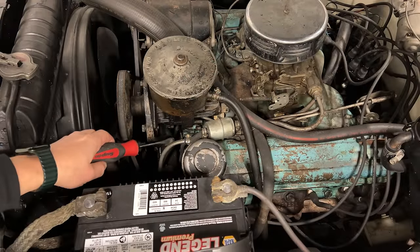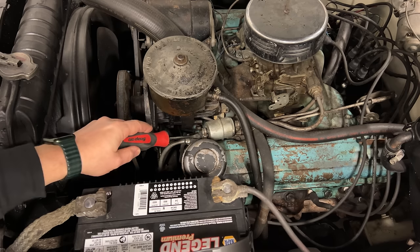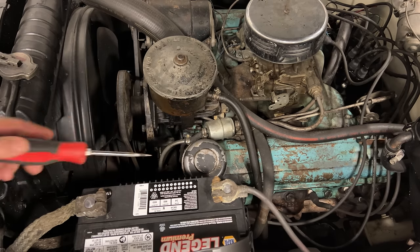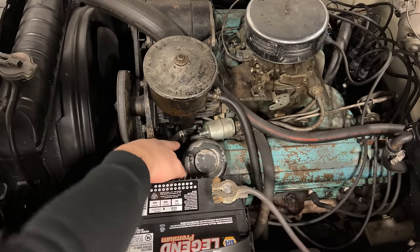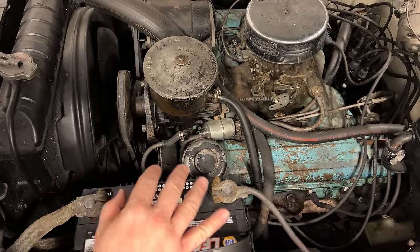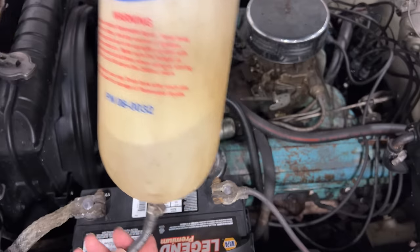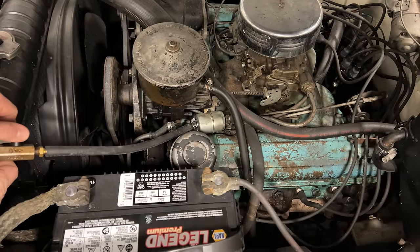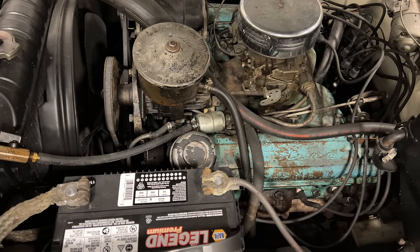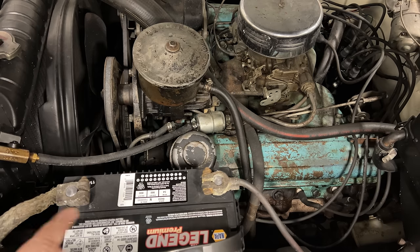This is a fuel line that comes up from the fuel pump, then it goes into a fuel filter, and then over to the carburetor. To see if we're getting fuel, I'm going to undo this hose right here. It feels bone dry there, so I don't think the fuel pump was running at all. I'm going to connect my fuel drip tank up to the fuel filter instead. Now I'm going to turn the fuel on — just wait a minute, make sure it's not going to leak everywhere. I can hear it going into the carburetor right now. Let's give this another go.